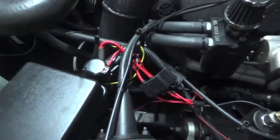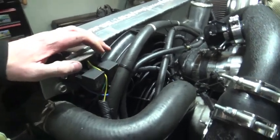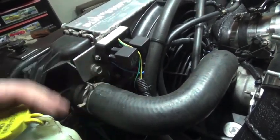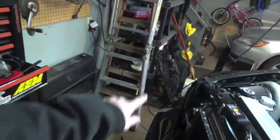For the two fans, I have two positive fused wires going straight to the relay box. The fan grounds run straight to the engine grounds. This green wire goes to your AC compressor — specifically the magnetic clutch for the AC compressor. Then there's a ground for the controller box itself, which I ran right there too since I don't have a battery up front. Overall it's pretty simple — just wiring in two fans — and it's way better than that crappy power steering hydraulic fan.